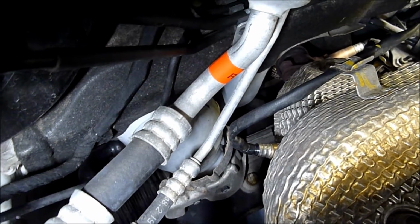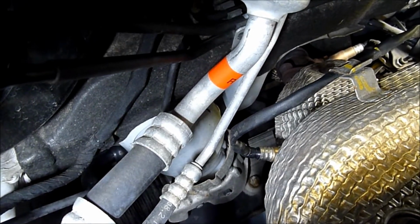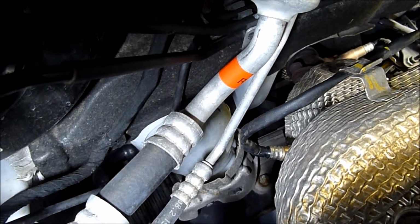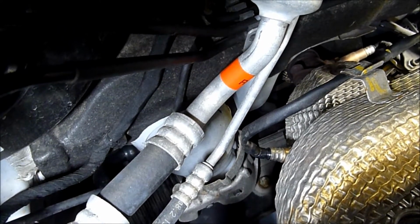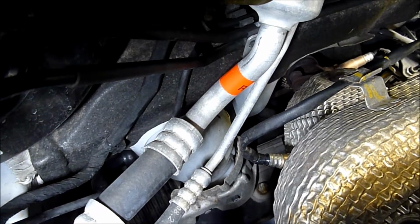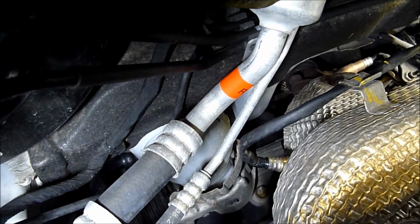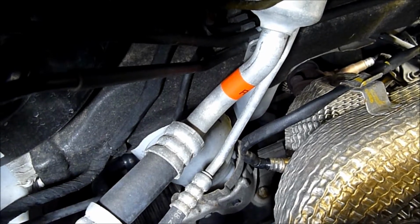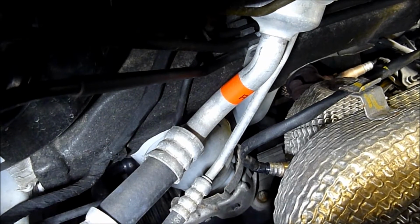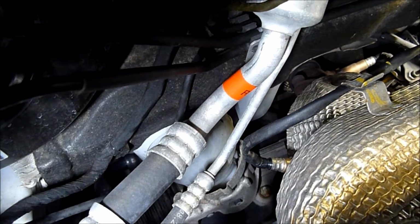So the exhaust gas oxygen sensor provides a precise indication of the stoichiometric air-fuel ratio. In a petrol engine, it's 14.7 to 1, so that's 14.7 parts of air to 1 part fuel. At the stoichiometric point, it produces 450 millivolts. The heated oxygen sensor does that, at exactly a lambda of 1.